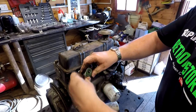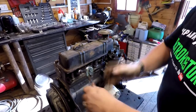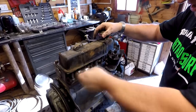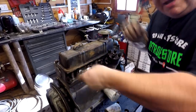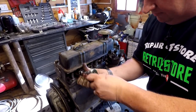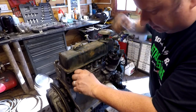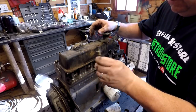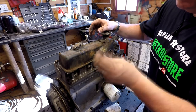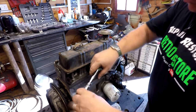I don't know the last time these have been out - definitely not in the six or so years that I've had the van. They're quite tight, a bit dry on the threads, so this will be an interesting thing to see - possibly the condition of the engine and how it was running pre-removal. There looks to be old plugs in there. Well, that's a promising sign - that looks lovely, light brown in colour. The mixture was actually perfect on that one by the looks of it. That's a good sign. Let's hope the rest of them are like that.